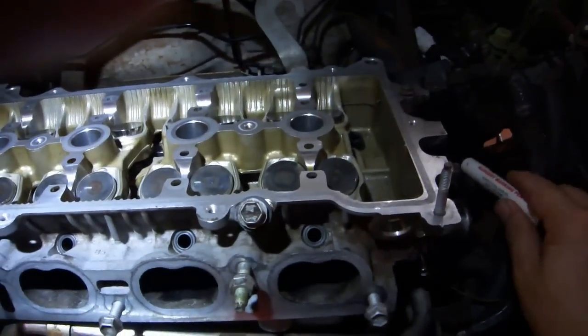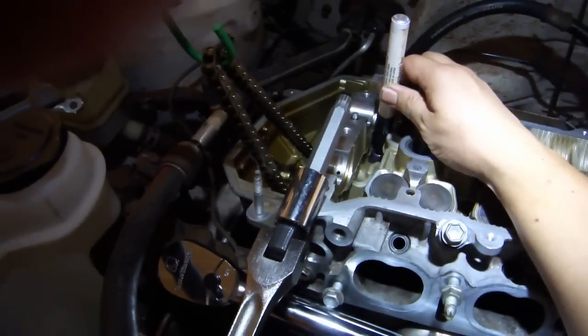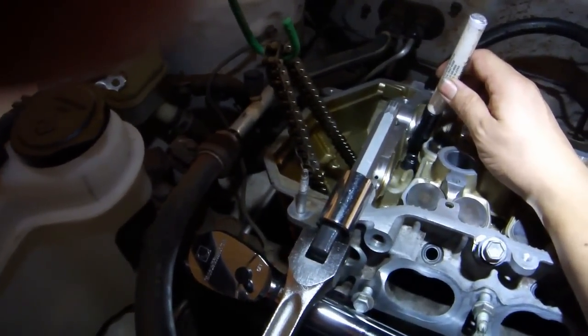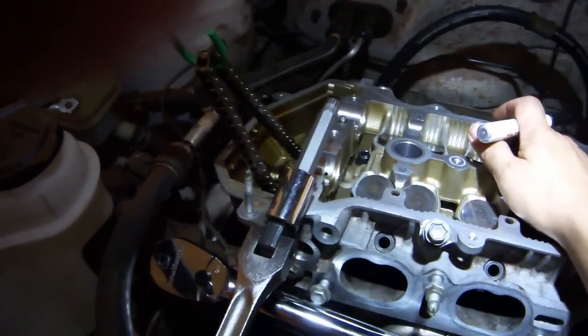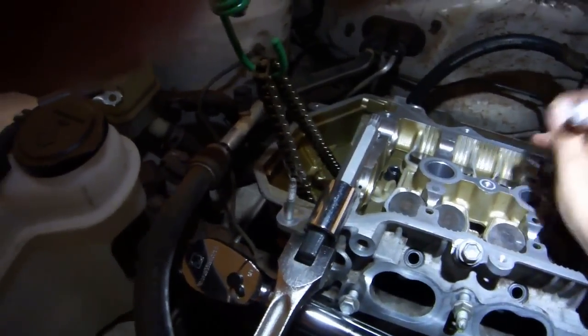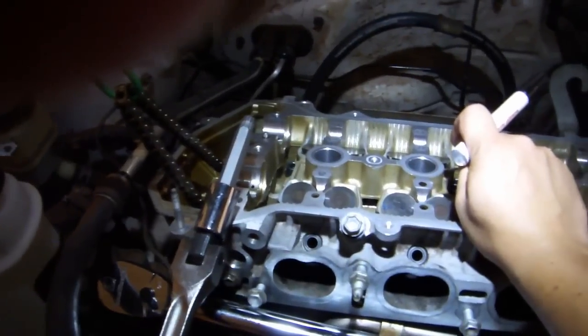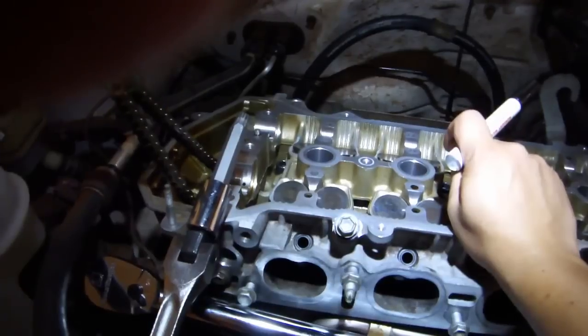Once I had it past the bypass hose connection, I had her run around the car and look down into this hole and line up the pin in the cylinder block with the hole in the cylinder head, and had her remove the shim once that was lined up. With the shim removed, I gently put the cylinder down, and of course at this point the RTV was squished into place. I then installed the bolt washers and bolts and ran them down with the bi-hex bit as fast as I could by hand,